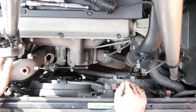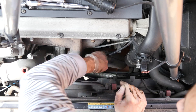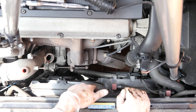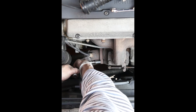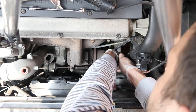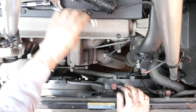Clearly the trickiest part looking at it here is going to be this exhaust clamp, because there's a bolt underneath that's going to be awkward to get to. We might have to take these fan units out — if we do, let's be careful not to touch the radiator, we don't want to damage its grill. You get like a nano turn every go — it's a pain.